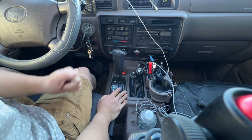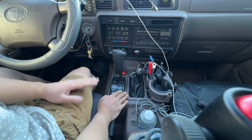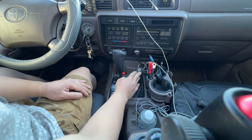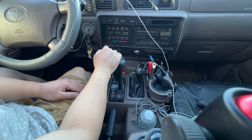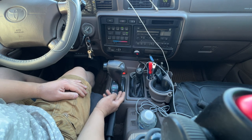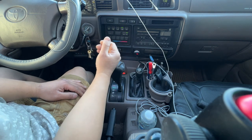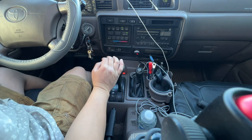Now let's talk about off-roading — what gears you should be in. Let's say we're going off-roading on a dirt road, flat level, maybe going 30 miles an hour. I usually leave it on high with the center diff lock on and I'll just be in third gear D3. I also have my overdrive off because I'm not going to go over 45-plus miles an hour when I'm off-roading. So that's high D3, overdrive off, center diff lock on. I also have my rear Grizzly Locker which is activated all the time as a mechanism.